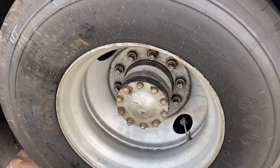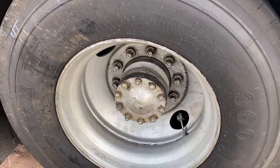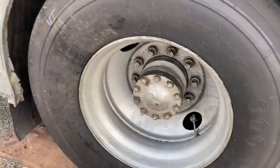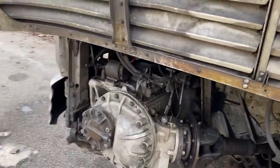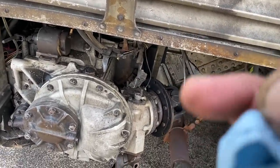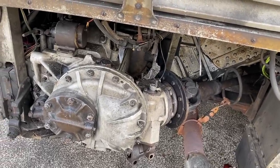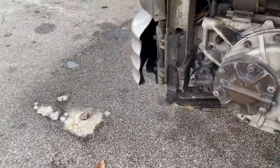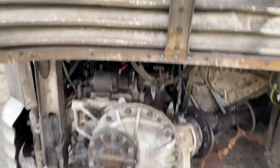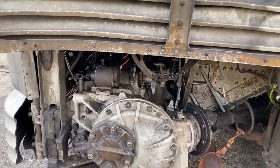I went ahead and ordered a pinion seal from Luke just in case I need it, so I got it with me, along with a new seal saver ring. I climbed under there, checked the differential fluid. It's perfectly full, so it hasn't lost enough to notice. I just barely stick my pinky in there, not even that first little knuckle, and it's halfway in, so it's real close to the top. Transmission, hopefully that little leak is fixed. Just snugged up a couple things, and that gear shift thing with it popping out of gear, that was a nice little find just by looking into that.